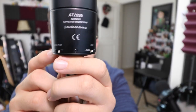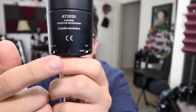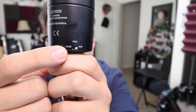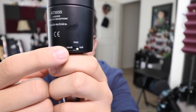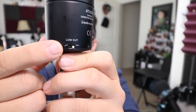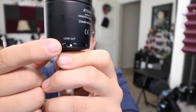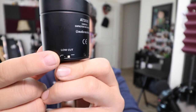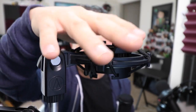Just like all the other 20 series microphones, the build quality of this thing is pretty awesome — it has an all-metal construction, a nice metal grill, and some really nice substantial weight to it. But unlike the AT2020, this does have two options on the back of the microphone: the first one is a 10 decibel pad, which helps when micing loud sound sources like a guitar amp, and the other is a bass roll-off, which just cuts a little bit of the low frequencies below 80 hertz to help with low frequency rumbles.